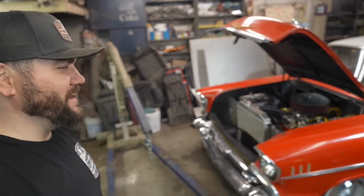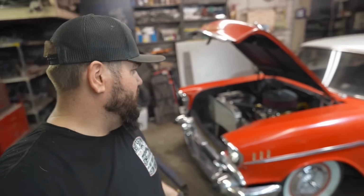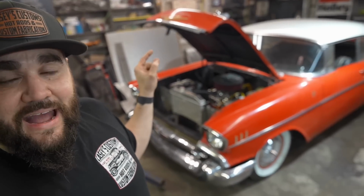So happy, man. It sounds great. It feels right. This is what it needed to have the whole time. And I could not be happier. Still have to do some stuff. Little stuff I'm going to probably do off camera. I won't make a full video on it. But we need to tweak a couple things. I don't know if the carburetor is dying whenever I floor it, or if I don't have enough gas. Because right now I have like 3 gallons of gas in it. So the gas could be sloshing around, I'm not sure, but it's probably the carburetor.